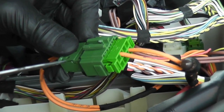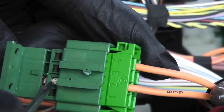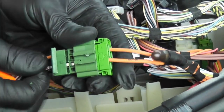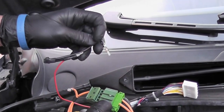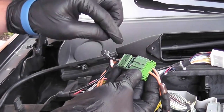Using two fingers, slide the green connector out from the ECU slot. Be very careful while handling this green latch. Use a tiny screwdriver to unlatch the green latch, then poke slightly into the triangular shape right here. Once poked in, you can slowly pull on the pin and remove it from the green connector. Grab the connector from the black proceed harness and slide it slightly into pin 2 where we moved the orange connector. If installed correctly, you will hear a small click. Now close the green latch.